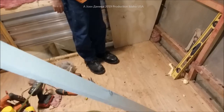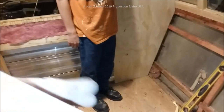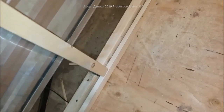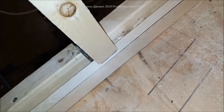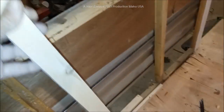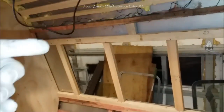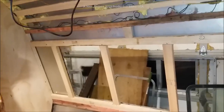of this side here. In the same process, the frame out over surface framing will be done with a bottom piece as well as these pieces, and everything will overlap, as you'll see here. So that is going to go in, and then this on top of it, and you'll see the multiples of overlap for strengthening. And that gives us a very stout wall with about an R9 to R10, hopefully achieved insulation value in most of the trailer, a good 85-90%. The floor is already getting refoamed, so it's going to be an R16 again, and the rest of this will be fiberglass with the foam over the surface of it, so that we have a high level of insulation in the whole trailer.